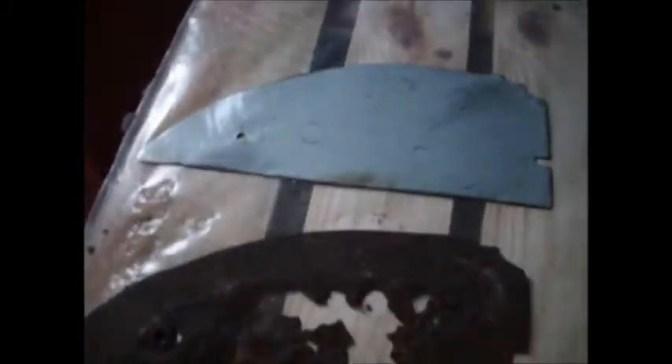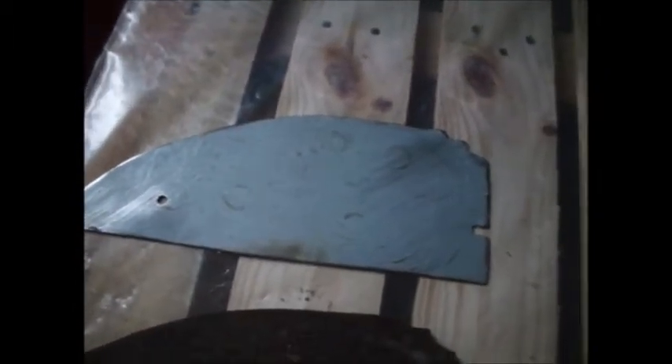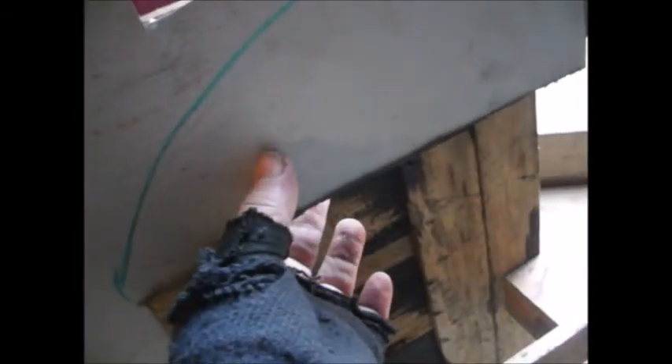It's a little bit later in the day. As you can see I've made the repair panel. I could have cut the rot out of the old one and patched it, but it's taken me about half an hour to knock this up. A couple of tips on cutting sheet metal: mark out the shape you want, then clamp a bit of wood into a vice and clamp the metal to the wood — it gives you a nice firm background. Always put a second clamp on.